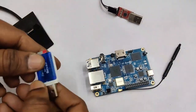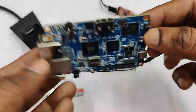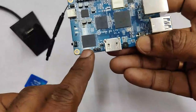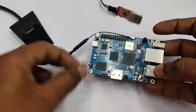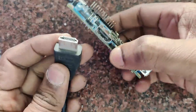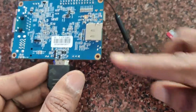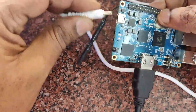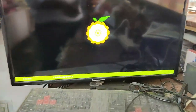The Orange Pi has by default Android operating system on the eMMC onboard flash, and on the SD card we have loaded the Linux operating system. Let us test both. First, without putting the SD card in, let us switch on the power to Orange Pi. Connect the HDMI cable of the TV or LED TV to the HDMI port. We have not inserted the SD card — now just provide the 5V 3A power cable.